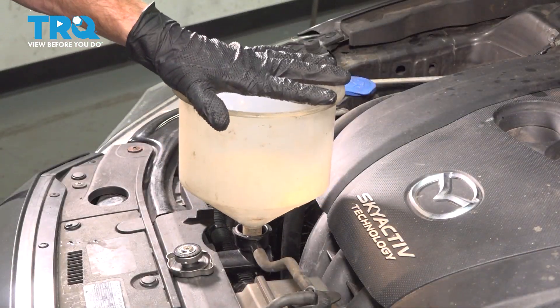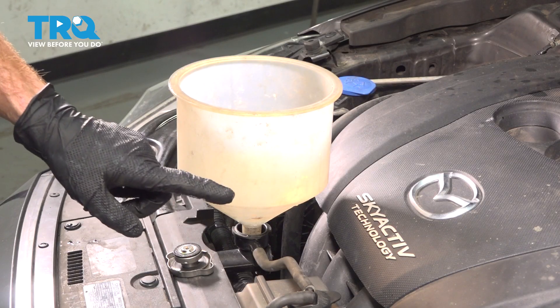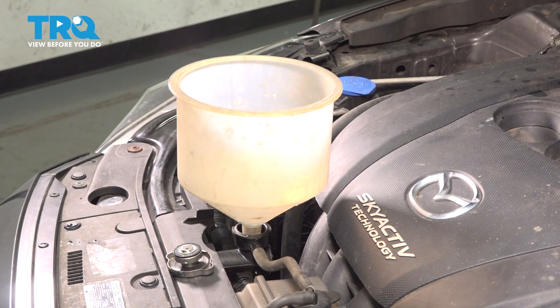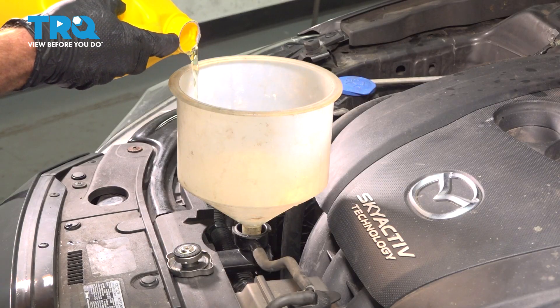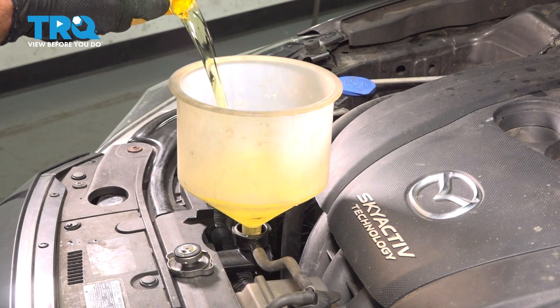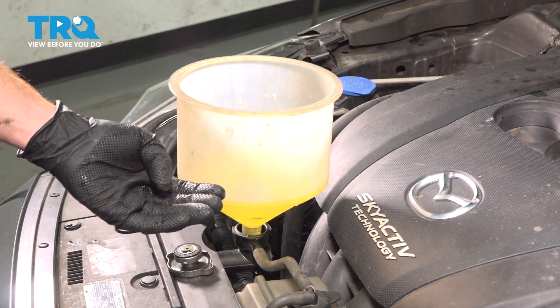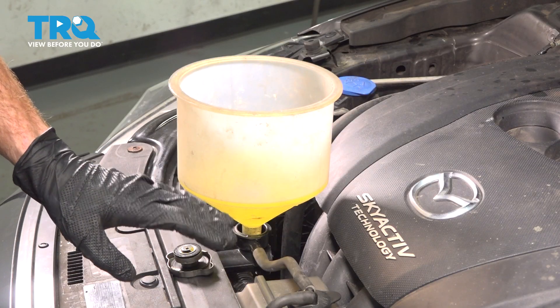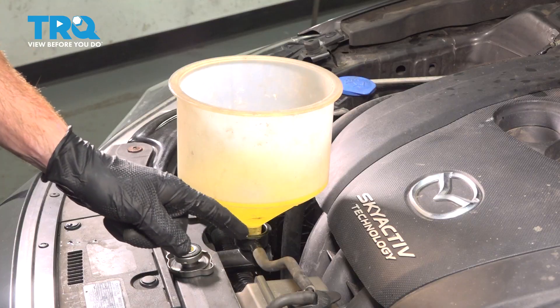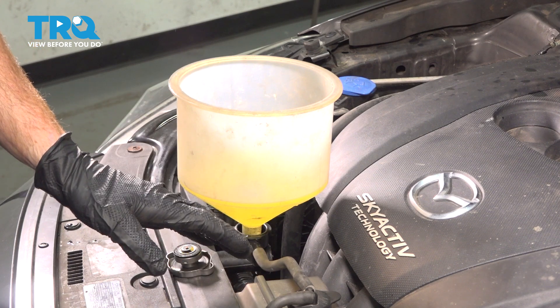It's time to fill the cooling system. There are several different ways to do this — one of the most basic would be having a coolant fill funnel. You want to use the adapter necessary for the radiator; in my instance, the funnel actually fits directly into the radiator so I don't have to use an adapter. We'll continue on with the manufacturer's specified coolant and top off the cooling system. Once you've filled the coolant funnel to the point that you don't see any air coming up and out and coolant making its way down, you need to run the vehicle until it gets to normal operating temperature. You're going to hear those cooling fans turn on along the front of the engine compartment. At that point, the thermostat should be opened up and coolant will be circulating throughout the entire system, removing any air.